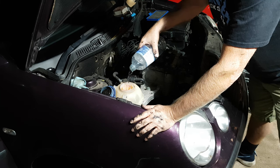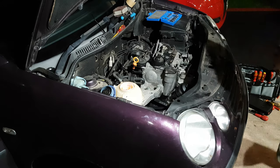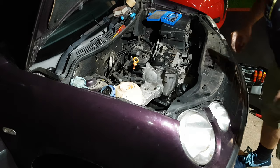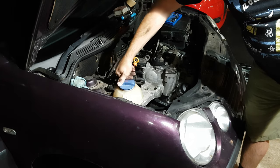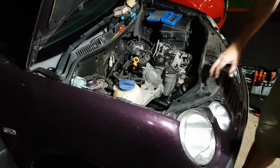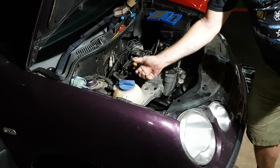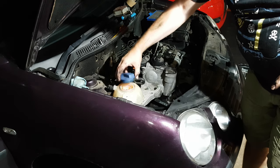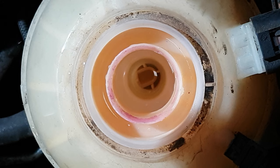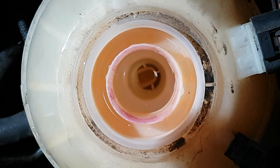You should of course make sure that you've got the proper water-antifreeze mix, but unfortunately because this is an emergency repair for us we're just putting water back in it for the moment. Once you've refilled with sufficient coolant, just put the cap on two or three turns and then you can start the engine. By leaving the cap loose it'll allow any air bubbles out, and you can take it back off to check the level and top up while it's running. As the engine warms up you'll see air bubbles coming out of the centre of the water bottle — keep an eye on that and keep topping up as necessary.